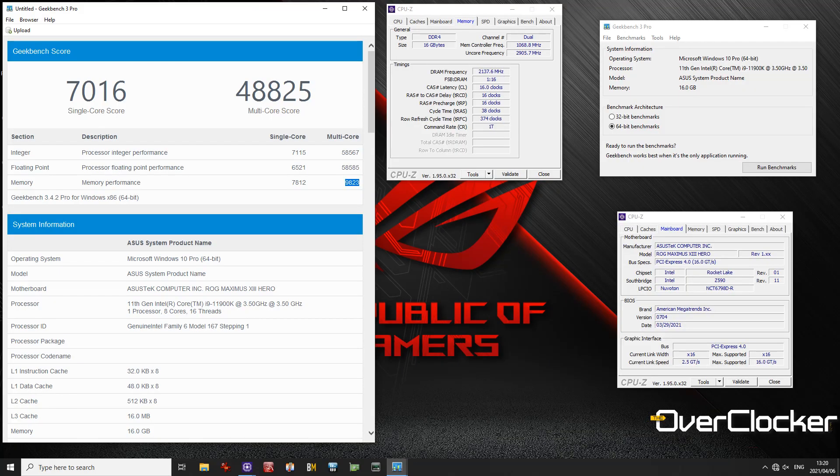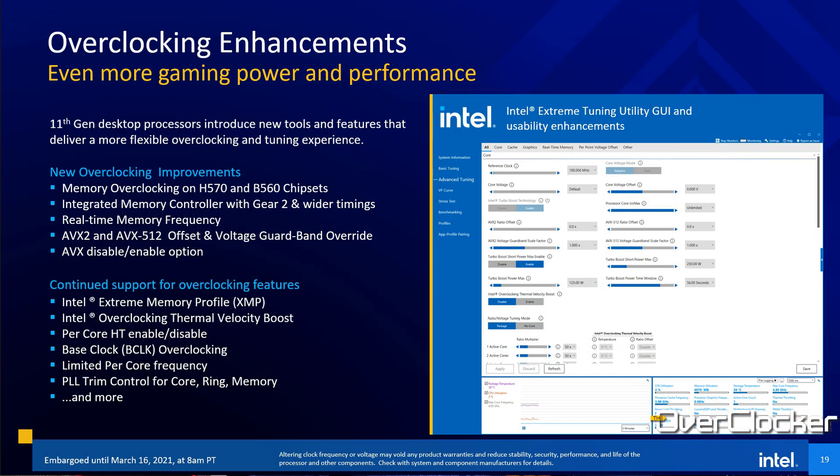For the benchmarks I ended up settling at 4266 CL16. The Geekbench 3 score came in just under 10k — around 9,800 or so. Since then I've been able to go much higher, almost 11k, but at the time of recording that was where I was. So imagine you'd bought this motherboard and that was all you could get — you'd be kind of disappointed, thinking that Rocket Lake is supposed to overclock memory better and this board is supposed to have better profiles, and yet you're stuck at the same DRAM frequencies you could have done with Comet Lake or even earlier.